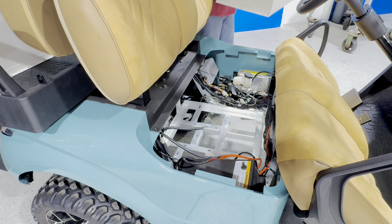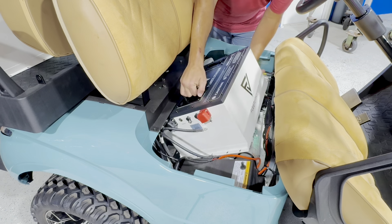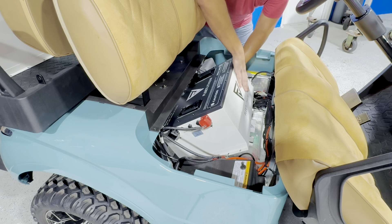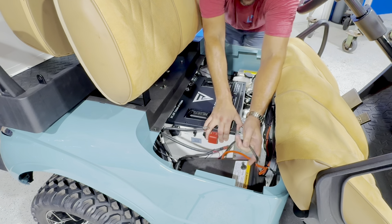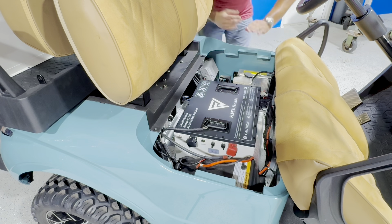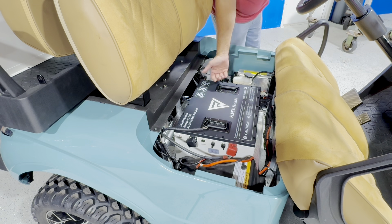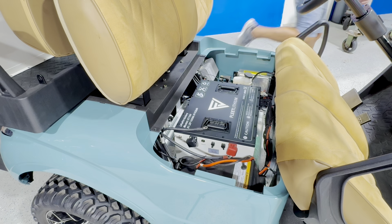While we'll be doing our final installation with the 51-volt 105 battery, I want to show you today how easy it is to install the 51-160 battery — and I was just told we're actually changing over to 150 amp hour going forward. So in the future you'll just see 150 amp hours. That was really the gist of installing the 51-volt 160. Next you would drill a couple of holes in the bottom of the frame, attach a couple of screws from underneath, and you're completely finished installing the 51-volt 160 or 150 battery.